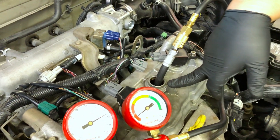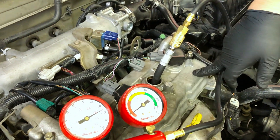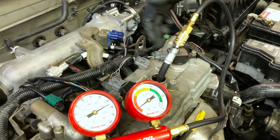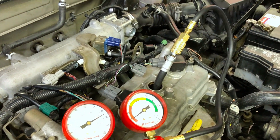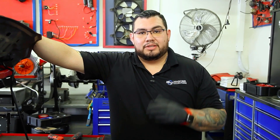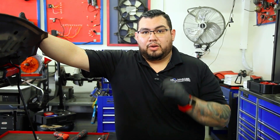If I was diagnosing this car and I have this same result, at this point I'm taking the valve cover off to see if these valves are adjustable. If they are not, that's an indication that more than likely this head is coming off or it needs a valve job. And that's it guys — these tests are not that difficult, and with this test you're going to pinpoint exactly where the problem is, just like we showed you with that intake valve issue. That's how you're going to be able to pinpoint where the problem is and what you need to do to fix it.